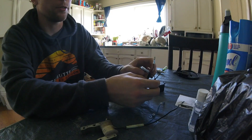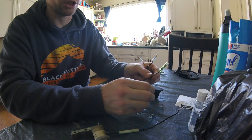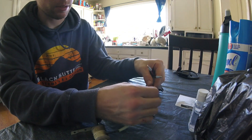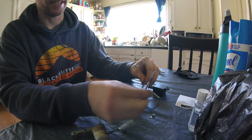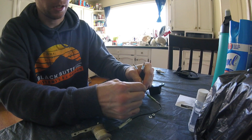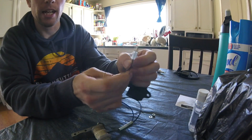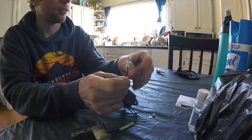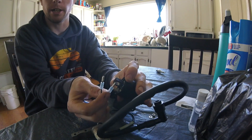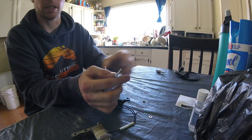We're going to wire these two wires here to the magneto, which has a red wire and a black wire. Black goes to black, and then this blue wire — your positive or power wire — is going to go to the black-red wire here. Plug those in together. Now on this end I actually have to cut this connector off and put on a piece that allows it to hook up properly — the black wire needs to plug into this, so I'll fix that quickly.